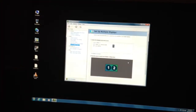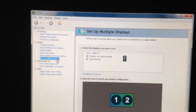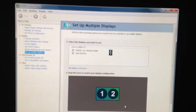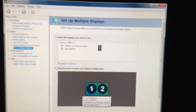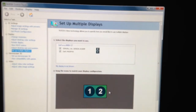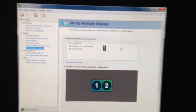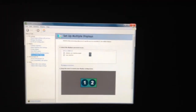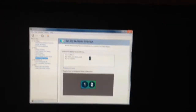The way that you do that is right-click on your desktop and click on the NVIDIA Control Panel. You want to come over here to 'Set Multiple Displays.' It won't look like this when you first set it up, but you'll see both of your displays. Mine showed the monitor on one screen and my receiver as another monitor — the Denon receiver. All I had to do was click 'Clone,' and that means just what you think: whatever is displaying on this monitor will display exactly on the TV.